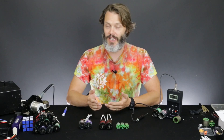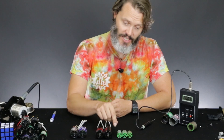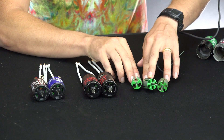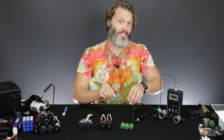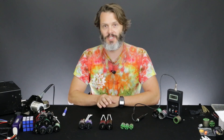What are the actual advantages of the five slot motor? We have here on the table one three slot armature and right next to it a five slot armature. The slots are pretty much what it sounds like — the slots that we wind the wires into. Because of these differences in slots, the turn counts are not the same between a three slot and a five slot, but we do list the equivalent KV on the website for easier comparison. The five slot Crawlmaster 13 turn is about the same speed as a three slot Trailmaster or Torquemaster in the 27 turn range.